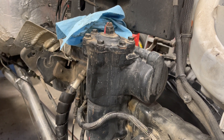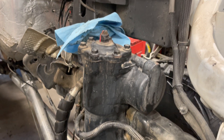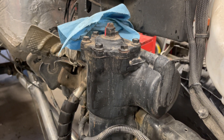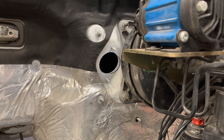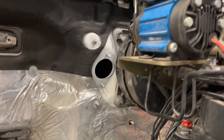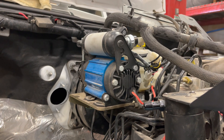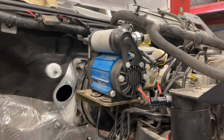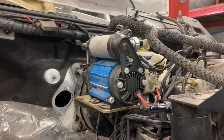This one's got a big bore box also, so we'll have to use our pulley to move the belt away from the big bore box. We've got to do the modification to the steering column — you can kind of see a scribe line there. And this air compressor is going to have to go, because this has PSC, so the PSC reservoir will go there and we'll relocate the compressor on this one.